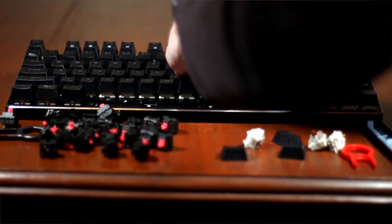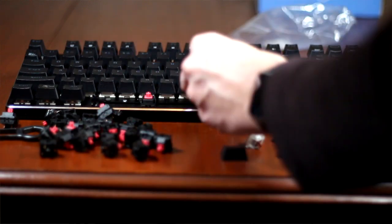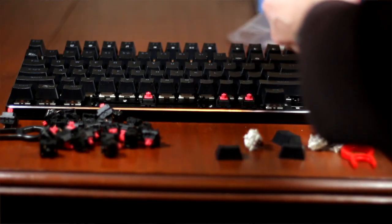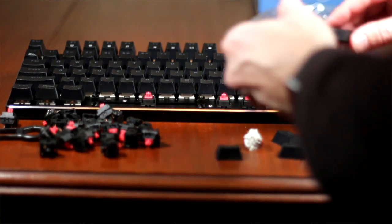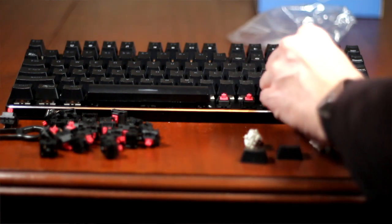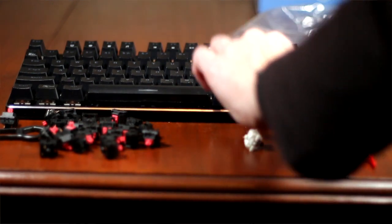For example, if you wanted to try out Cherry MX Speed switches, the swap-out process works like this: use the keycap puller to remove the keycap, then use the mechanical switch puller to remove the switch by sliding the teeth of the puller into the slots on the top and bottom of the switch, and slightly wiggle it until it disengages. On a TKL keyboard it takes about 30 to 45 minutes to remove and replace all 87 keys, with zero risk of bad solder points.